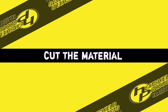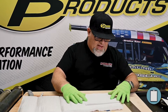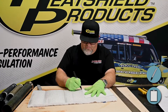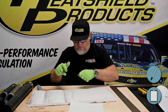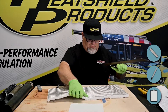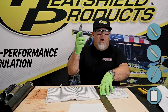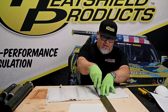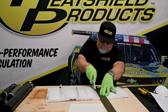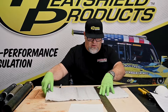Okay, so let's cut the material. Here's a piece of heat shield armor. I'm just going to drop my template right on top here — I'm going to try to save as much as I can. I'm going to make myself some marks, then I'm going to use our straight edge and cut the material. One thing I will tell you: if you start on the outside and pull through, and your blade is not sharp enough, you will tear the aluminum. So I like to poke in about a half an inch, pull back, then come back on this side and cut through the other side. That way I have a nice clean cut — same thing here for the corner.